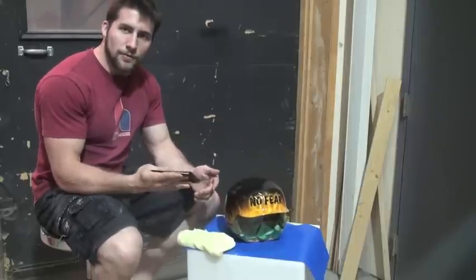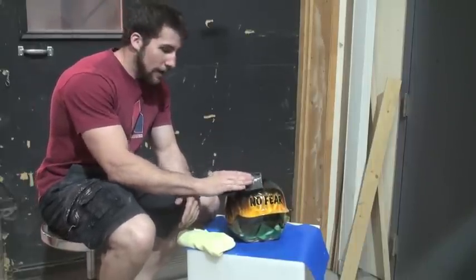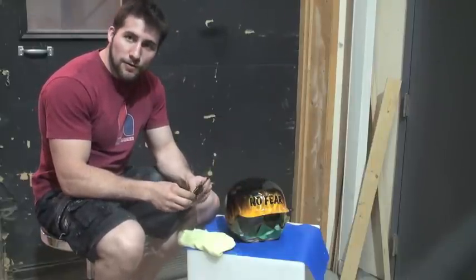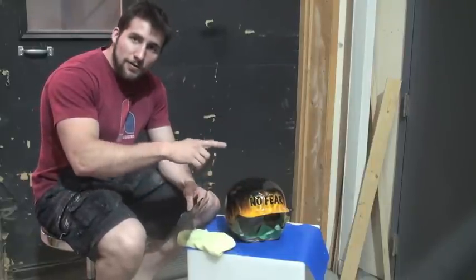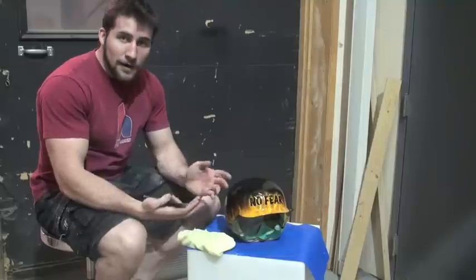But sanding with your fingers can actually put grooves into your clear coat and make little waves, and you don't want that — you want the flattest look possible. Obviously if you can use a sanding block on something flat that's going to be even better.